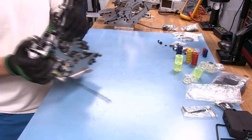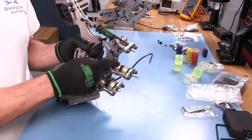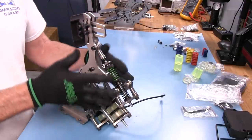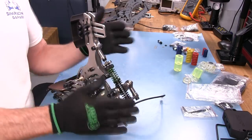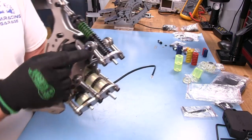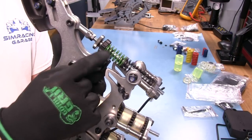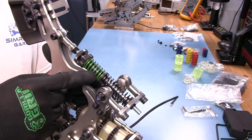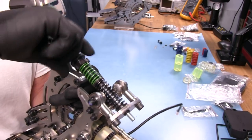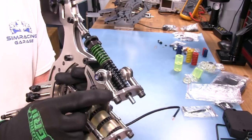So we also have this spring, and I'm going to show you a shot of that preload spring. And this is going to give us a different feel than just having the bumper stack over here. This is going to push back in a different way than the bumpers can push back as far as their spring feel. And this also, when you're first pushing it, can feel a little different too. So either way, and this is a pretty simple thing. Again, we put some rod ends on here, and we're not going to be using any spacers on these. See that? And the reason is we've got all the preload adjustment up here. All we got to do is turn this piece here, and we can adjust our preload up or down. And then we'll lock it down with this steel thumb nut, or finger nut, I call it, on the top of that, so we can lock it down, it won't move. So we don't need the preload adjustment in this part, so it can just kind of hang there.